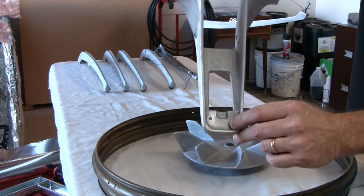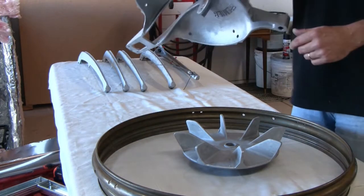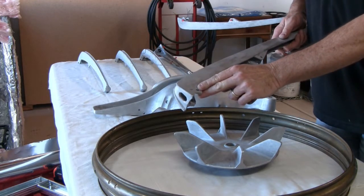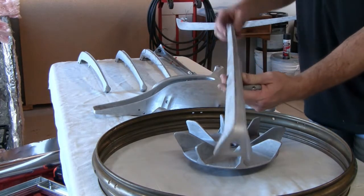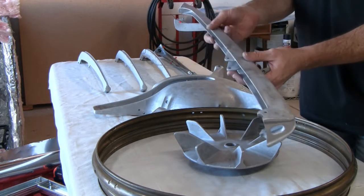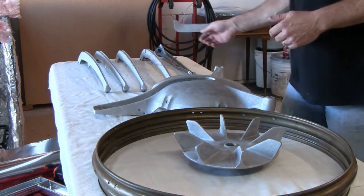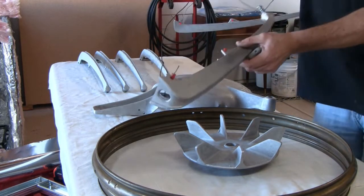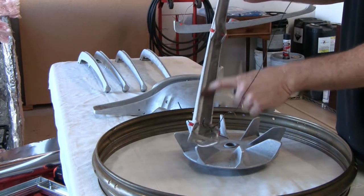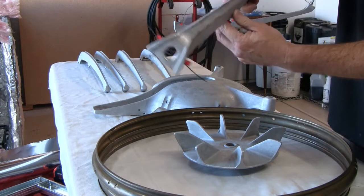This is an original factory repair that filled a small drilling void in the casting. All of the struts needed some repair, but fortunately I didn't find any cracks or severe damage. I had to smooth and fill the dents with a conductive aluminum epoxy filler. The insides and edges all looked great. This strut is all wired for hanging in the oven. The critical holes are plugged, and it has a nice smooth finish. These are a couple of the repairs from deep gouging, and the dented outer edge was sanded to make it cosmetically match the other struts.